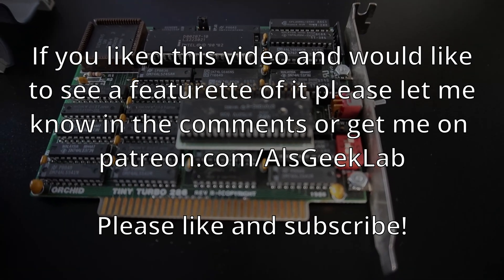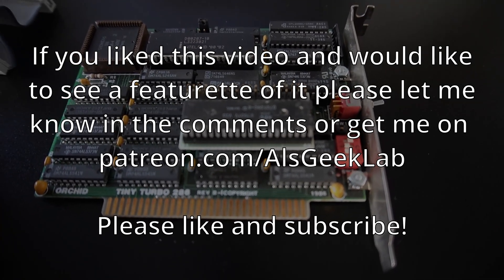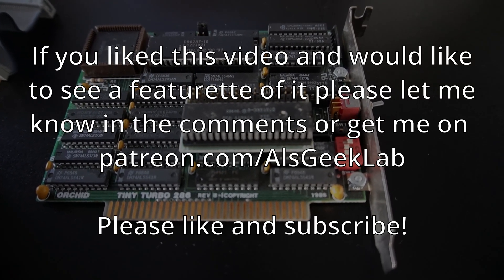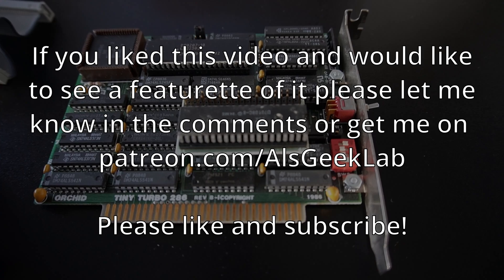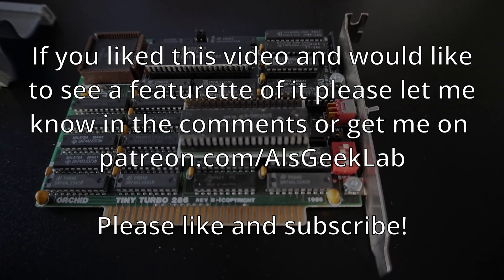So there's a whole bunch of trade-offs you are making by upgrading an XT machine with an 8-bit bus rather than having a proper 16-bit low wait state machine. But it gets you most of the way there, and it's still a cool option for a lot of people who needed that extra speed boost in the mid to late 80s and couldn't afford to buy a fully new machine.